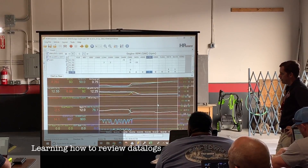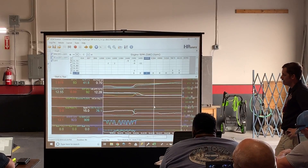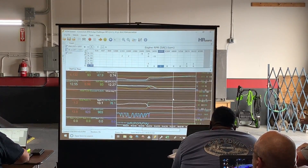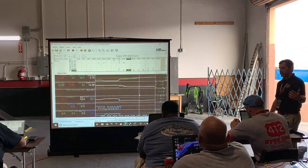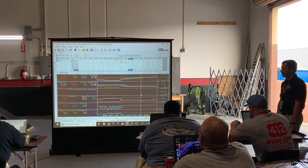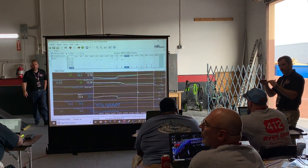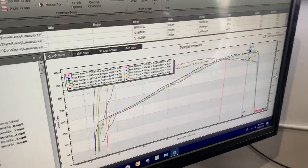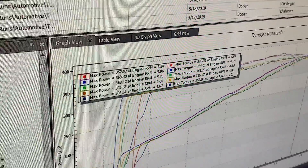It knocked out. What RPM is that? 4,000. So we can try to fix that. We tried to carry out 15 to 48, but it's knocking at 15 now where it wasn't before. We could try to dig that hole - remember how we talked about digging that little trench, the little bucket, around 5,000 RPM a little bit more? Here's what it ended up making - just some small gains. It kind of ran out of time and had some bad fuel in it we think. Day one is done - we're going to unstrap this and continue tomorrow.